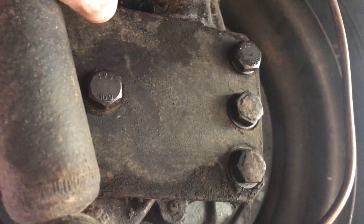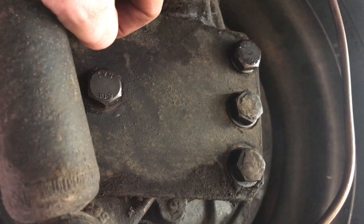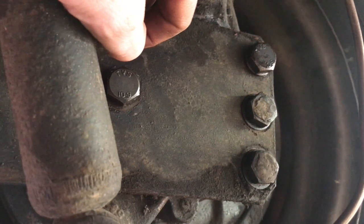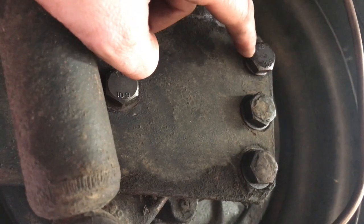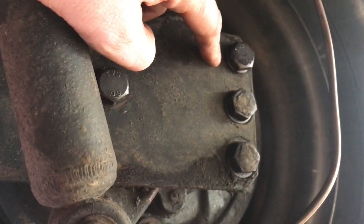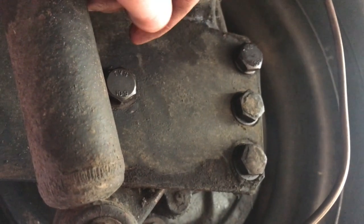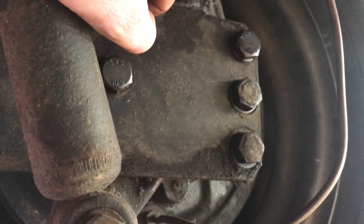So what I'm gonna do is actually weld the bolt to the spring plate on a place where I could get a roto-zip in to cut it if I need to take them out. So that's what we're gonna do. We're gonna back this thing up over to my welder and put it up on some ramps, and I'm gonna crawl under here and just tack each of these in probably a couple places just so they don't back off again, because I definitely don't want that to happen again. These are notorious for backing out. They are notorious for stripping threads, and you have to helicoil them or something annoying like that. So I've got 8 of those to do, and then this girl, or I should say boy, since it's rusty, should be ready to ride.